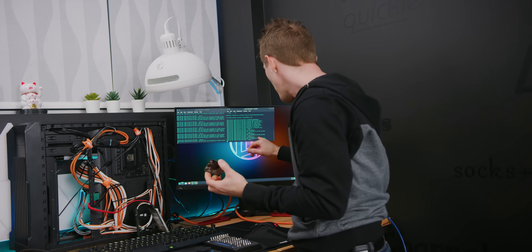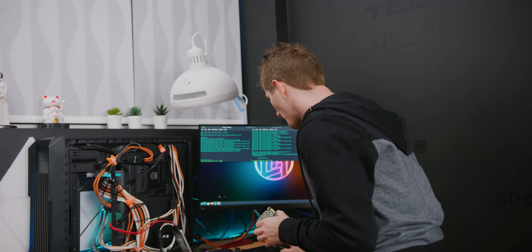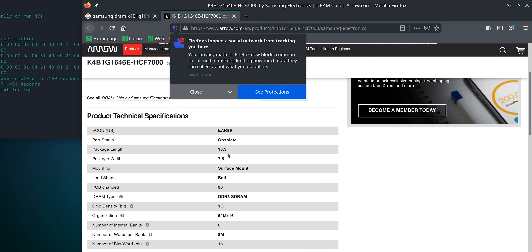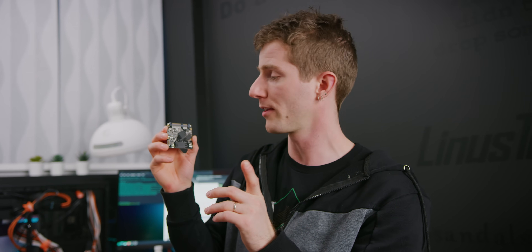The Micron SSD benchmark is done and it's definitely better — but not necessarily because it has a DRAM cache, probably just because it has better-engineered firmware and a better controller. We check the part numbers: that's a DRAM chip — DDR3 SDRAM, one gigabit, so 128 megs. Surprisingly then, as broken as the packaging and product page were, the main controversial element — whether or not it had a DRAM cache — ended up being true. Although, the power loss protection did not end up being present. There's no bank of capacitors here, so that claim is clearly not accurate.